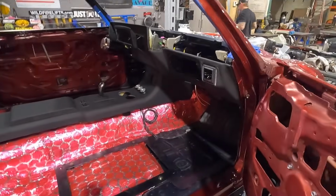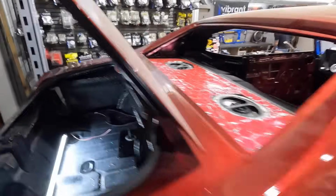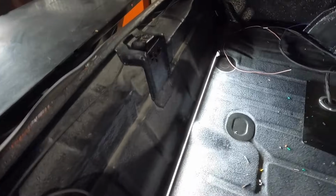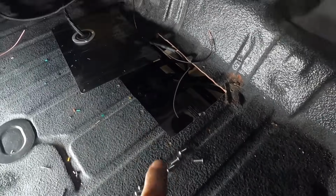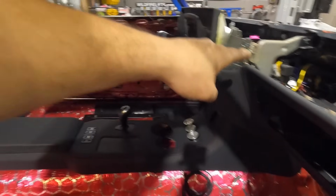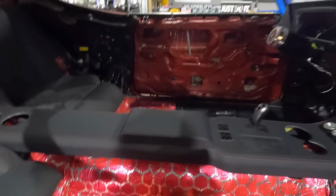With the R5, we're also using a PD16 in the trunk of the car to give everything back here: exterior lights, fuel pumps, fuel level sensor, our ethanol content sensor that's also down there in our return line for our fuel system, all wired straight from that PD16 that we've got mounted in the back right there. We have all the information and the triggers being communicated to that PDM from the VCU with a single CAN cable that's going from the front to the back. So it eliminates a lot of the wiring that's going through the middle of the car.